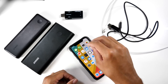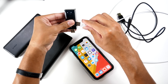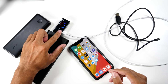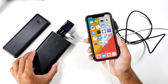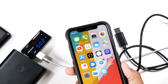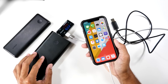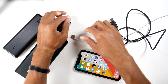Let's test out what results we get with our iPhone X using the provided Apple cable. We'll plug that in and then plug this into the quick charging port. We're getting 5.17 volts. It is for sure charging — that indicator at the top came on. We're sitting around 5.02 volts and about 1 amp. That is pretty normal for a standard Apple cable.